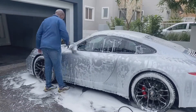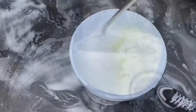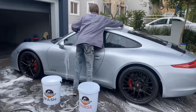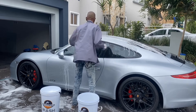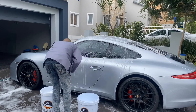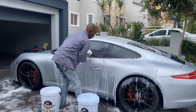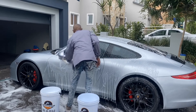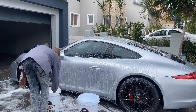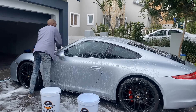This is the perfect time to clean the window rubbers using a detail brush. Then onto the contact wash using the two bucket wash method — one bucket with shampoo, the other with clean rinsing water. You wash one panel, rinse the wash mitt, dunk it back into the shampoo bucket, clean a panel, rinse, and so on. It is the safest option to begin washing from the top down, as the bottom is filled with a lot of contaminants and dirt, and you don't want to risk scratching the vehicle.